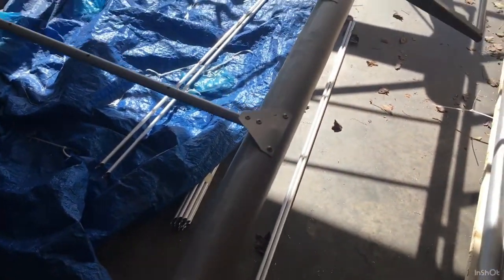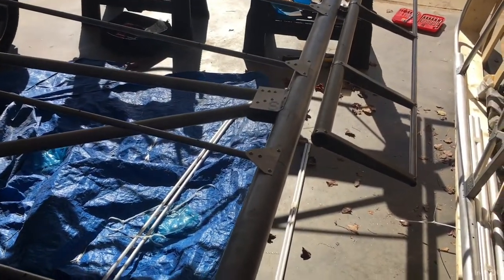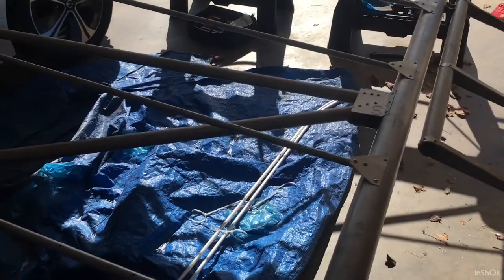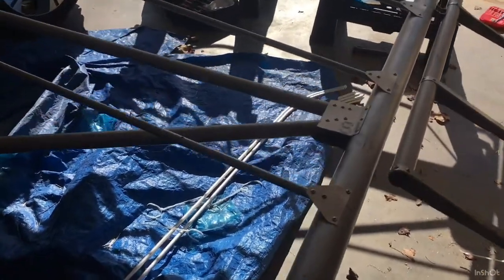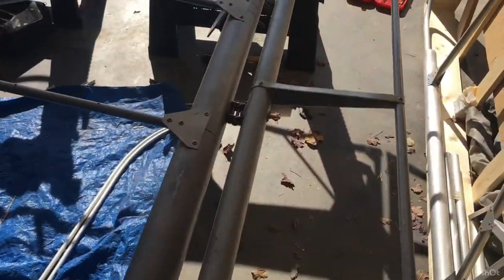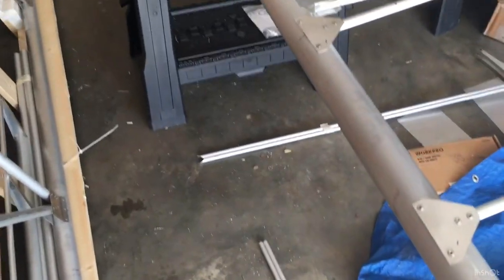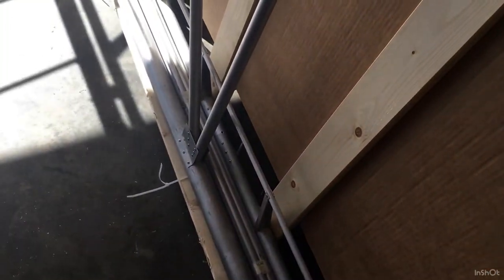You rivet them in place and you've got to make sure they're level — that's really important because it's part of the wing surface and you don't want it producing lift in that area when you don't want lift. After that comes the push-pull tubes, and I'm not sure about the lengths yet. I haven't even taken them out yet, but that's the last thing I'll work on. I'm still waiting on the threaded inserts and I think I have the ball joint heads.